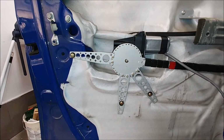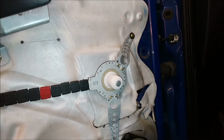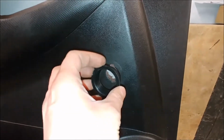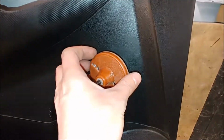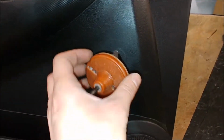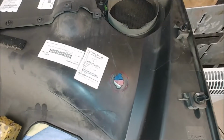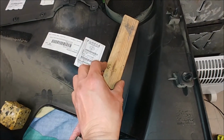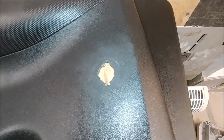That's what I came up with in terms of mounting bracketry. Now I need to make this hole larger to put that masking bit here, but how do you do that when there is nothing to support your drill bit in the middle, so that it would not make a mess, scratching everything around? My solution is to hot melt this piece of wood here so that I can drill a hole in the middle that will support my drill bit. Perfect!